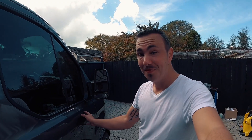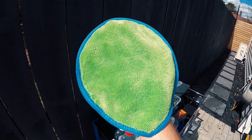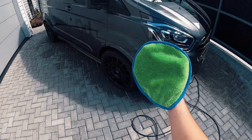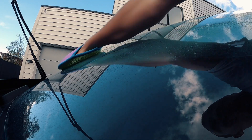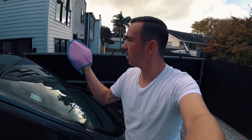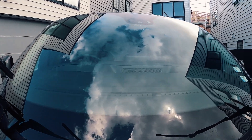Once you've dried down the whole car using Afterglow it should feel absolutely silky smooth — which it definitely does. Next step: glass. Bowden's own have released this new mitt called the Intimate. On one side you've got a high pile side for adding two sprays of Naked Glass, then you go around with the low pile side and buff it off. It's that simple and it works really really well. A simple north-south-east-west motion, making sure you're overlapping each stroke, will give you the best finish on glass. Once you've sprayed it all on, rotate to the pink side and just wipe it off — that's how you get a non-streak, super shiny glass finish.